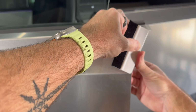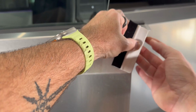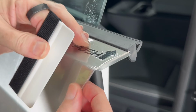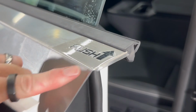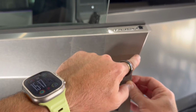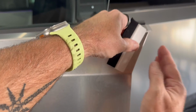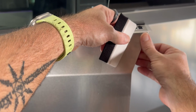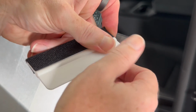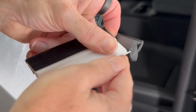but the point is we're going to get a really good, tight roll over on that, and because it's fairly dry it's sticking straight away, and there's no little bump here, which is where it occurs. So you really want to push hard on this and then stretch it around the edge as best you can. I'm going to do the same up here. So really put a bit of pressure on there, pull it around, fold it under.